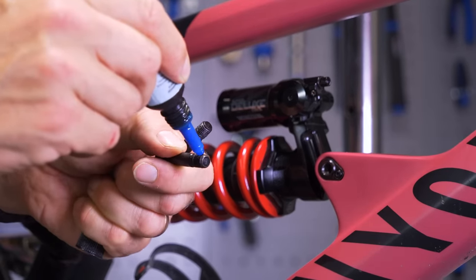This is where things are a little bit different to an air shock. With an air shock, you can infinitely adjust it to get the perfect sag. Getting the correct sag is really, really important because you can change the whole feel of the bike by having too much or too little. If you have too much sag, you'll sit too deep in the travel and the bike won't feel as responsive. If you're running too soft a coil spring, the bike will feel really wallowy with not enough mid-stroke support, and your cranks will be closer to the floor.